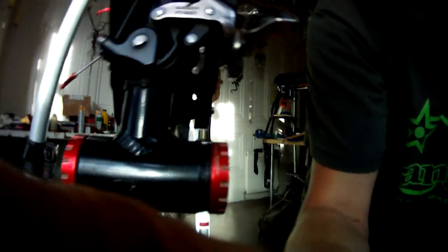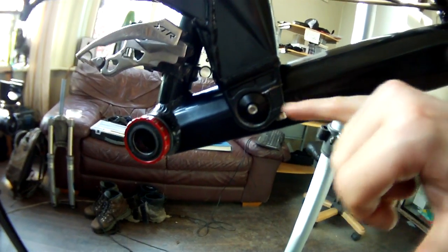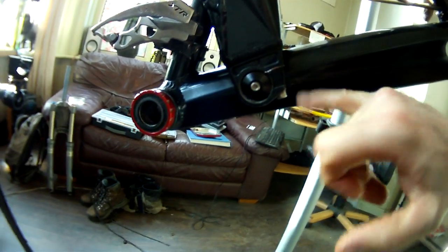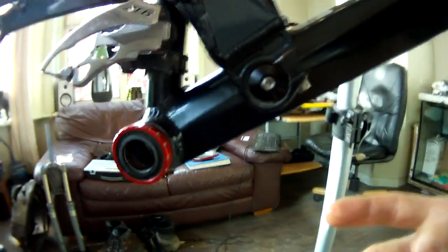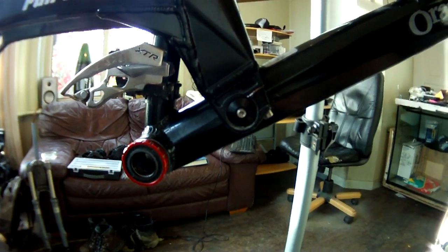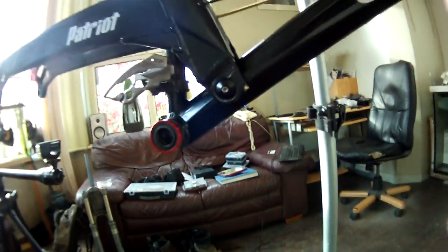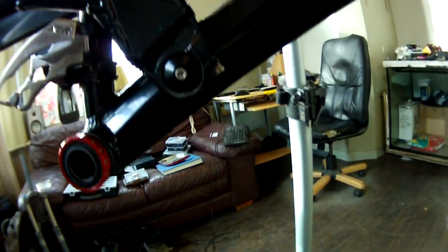You see what's happening here is I put grease on all the points, yeah? Because I've tightened that up now, it's squeezed all the excess grease out, and we need to get rid of that. Because we don't want it to keep muck there, do we? That's how we're going to do it. We're just going to wipe it all down. But that, my friends, is a bearing change on a swing arm of an Orange bike. Still got this wedge to put in the other side. But that is essentially it. Thank you.